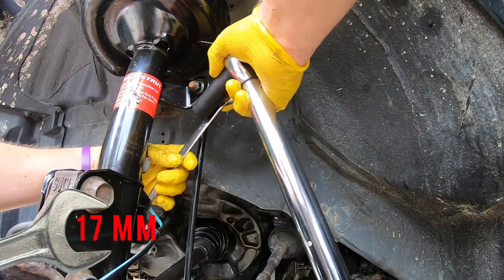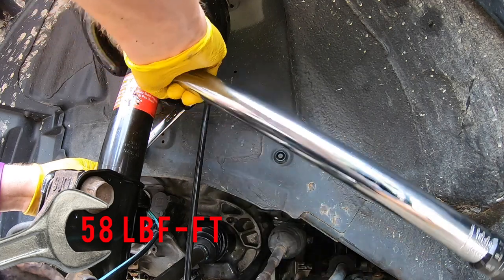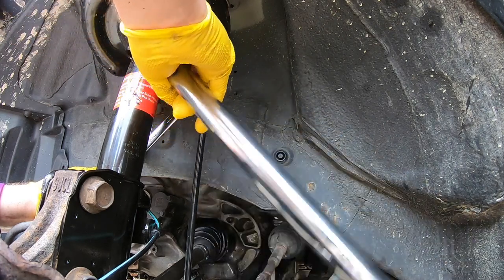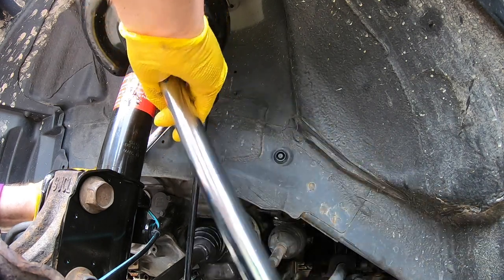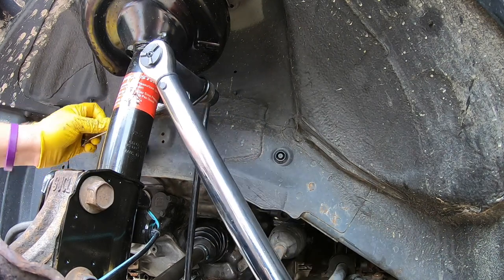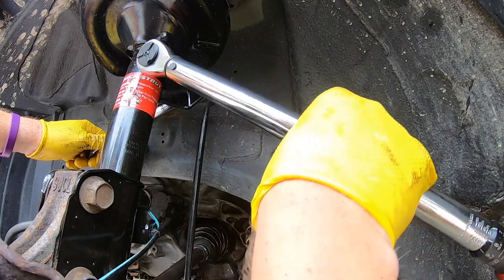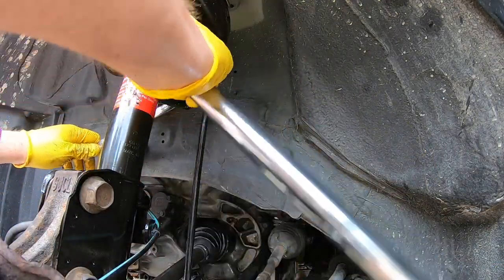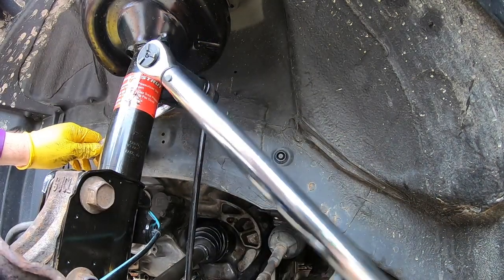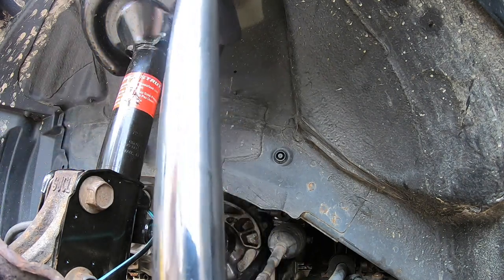We're gonna take a 17 millimeter, we'll go ahead and put that up on the back side. And then we need another 17 millimeter. That will be 58 foot-pounds of torque. All I have is my big heavy duty one today. I didn't pull out the small one, so it may take an extra second or two. And you're kind of cramped on space in here, so you're just going till it clicks. There it is. So that's tightened back up to spec,